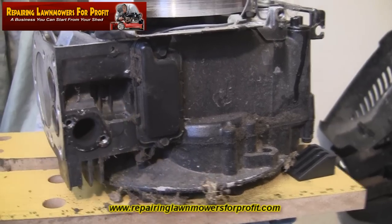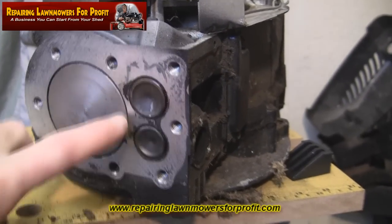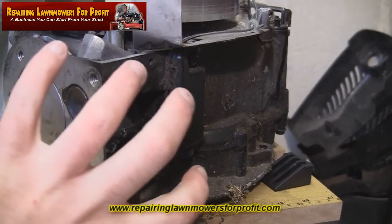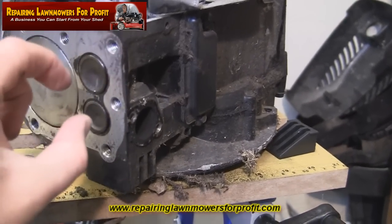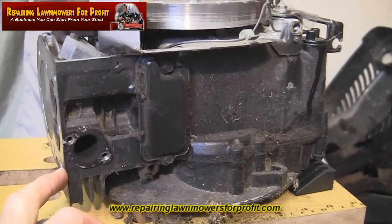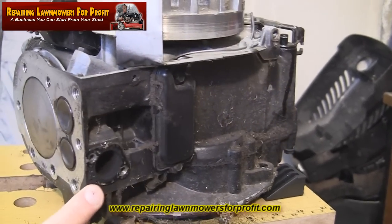What happens a lot if that occurs behind the exhaust is that this block here will overheat. As you can see on the front here, these valves have valve seats around the outside. They're designed to run at a certain temperature — if you get a blockage in here it will increase the temperature of this main unit, and what happens is it expands but the valve seats pop out, and of course you can get a stuck valve. So if you take the exhaust off to have a look at these valves, just have a look in here and make sure it's cleaned out, because if it's not your engine will overheat, run a bit rough, and eventually it'll pop these valve seats out.